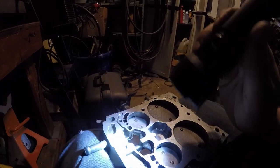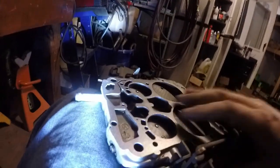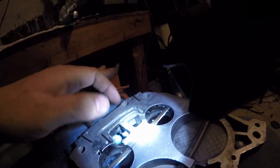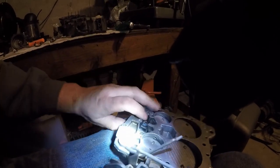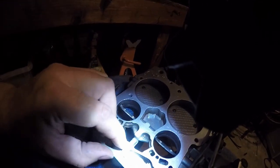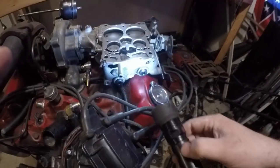The factory modified that — instead of having this hole go to the bottom of the carb to vacuum, it had it come out a port on the front. This wasn't made to do that, so I had to modify it. What I did was take some JB Weld and fill all this in — you can see this here — I JB welded the whole thing all the way up in here. Once it was all JB welded up, I drilled a hole in the front right there, drilled it all the way back to where this hole is, and drilled this back out to meet it. So now it doesn't come out the bottom — it comes out the front right here.